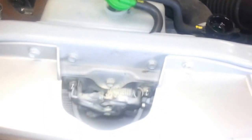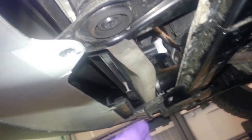So let's go down and show the radiator drain plug. And the radiator drain plug, I took this cover off, and it is right there. And you can reach this from in behind here, in behind this cross member right there. You can reach, I don't know if you can see my finger right there. So I'm just going to loosen that, let the rad drain, take out the block heater. Hopefully that'll get most of the coolant out, and then put in some pre-mixed coolant there.